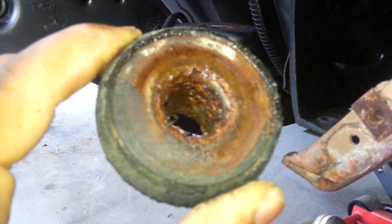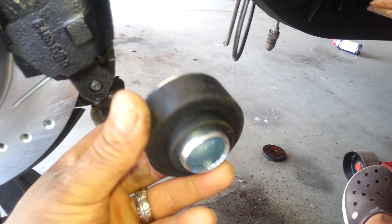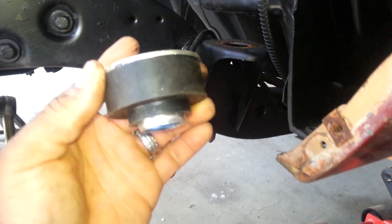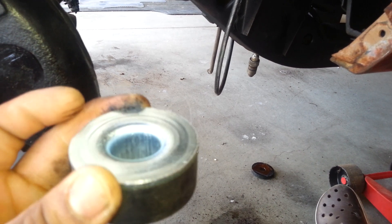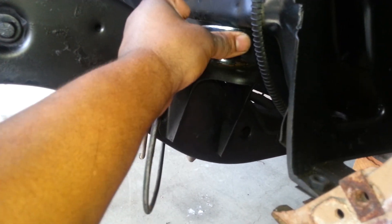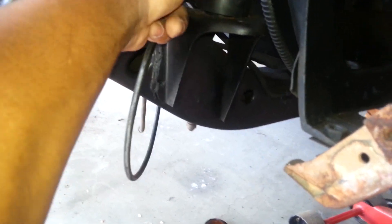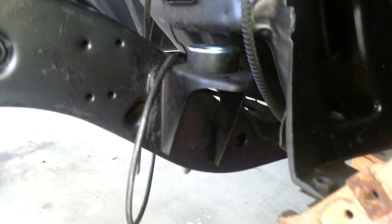But make sure that you soak those bolts really good. And don't forget how it goes — it goes like that. I've got my extra bushings down here, just some stock bushings. If your car is going to be outside in the driveway, under the weather, I'd recommend the polyurethane. But since all my cars are garaged, I just use regular old stock rubber. And that sits in there like that, and then the other piece goes on top of that, and then that bolt — don't forget how it goes — and then it goes right up there. Same with the other one.